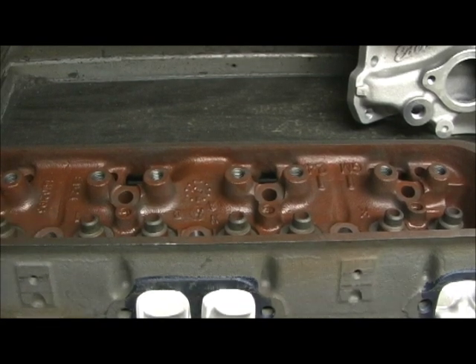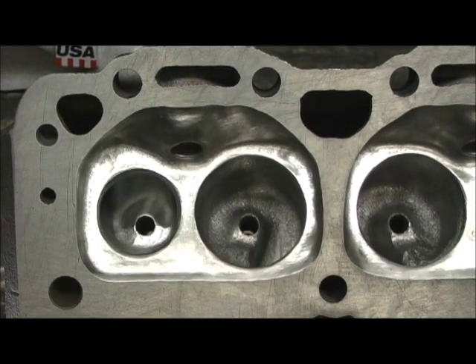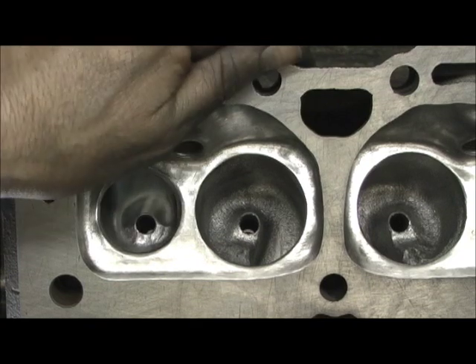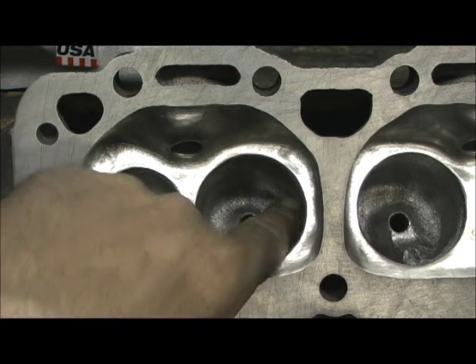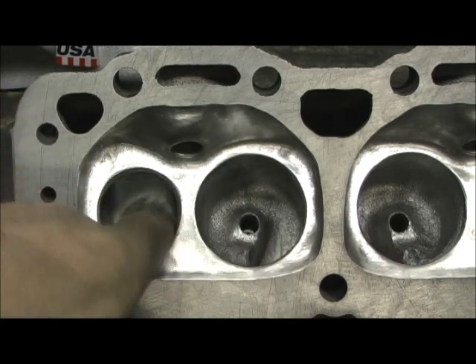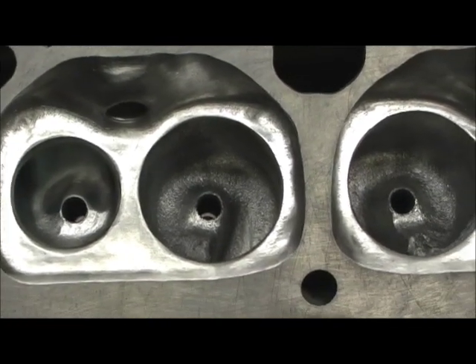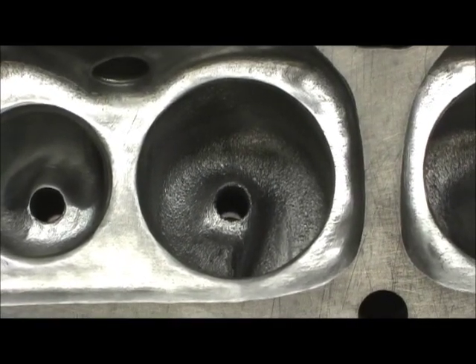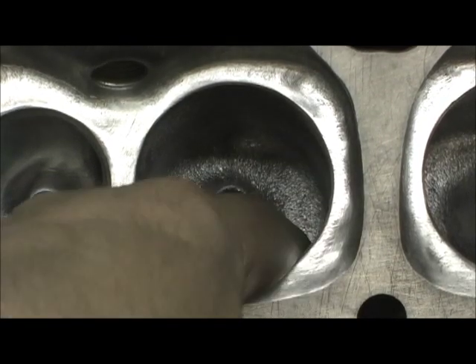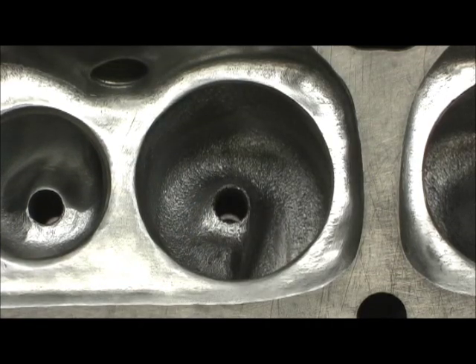Let's take a look at the combustion chambers. Like I always do on all my heads, the intake port is left in a rough finish — carbide rough. It is a single carbide cross-cut. And the exhaust ports — bottle nose, just like the intakes — rounded to the 440 grit finish. I just can't tell you how much of a battle those bowls were. That is really a lot more work than what you can imagine, a tremendous amount. When you use math and the go/no-go gauges and figure out what you're going to do to get them to cross-section out from here all the way around the bowl and come up — this thing was just a disaster from GM.